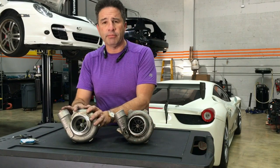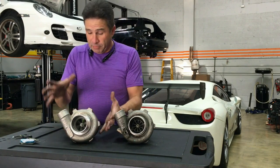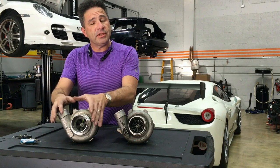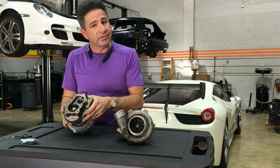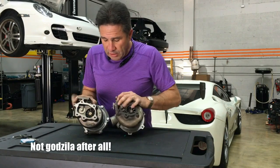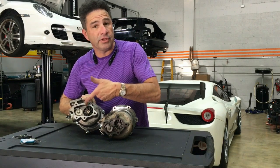This is the 3071. But it's not just any T3 Series turbo. Any T3 Series turbo wouldn't fit — the compressor housings are huge, and you have a very unique space, and it certainly would have too much lag. This is a T3 Series turbo, but it comes with a T2 housing. The main differences in this T2 housing are going to be the size of the wheel and the size of the exit of the exhaust.